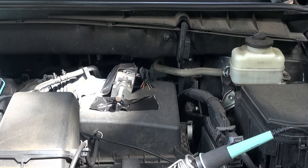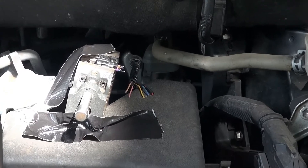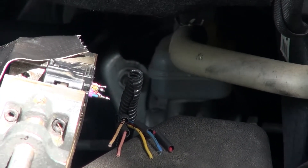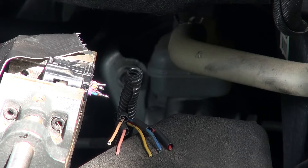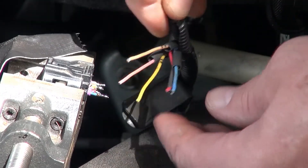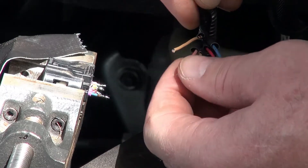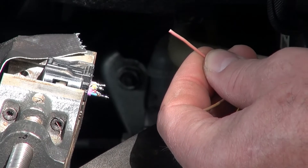I've got the short wires on the connector tinned and it's in a clamp. I'm going to temporarily tack the wires back in place and see if I can reset the code and drive it around — there are some other things I want to do. This is just a temporary repair; I'm going to have to replace that pigtail because the wires won't have proper strain relief and they would break again. But it'll work for a few minutes while I move it into the shop. Here are the wires tinned, and I've got them marked with stripes. Starting with pin one — closest to the wiring harness — that's this pink wire, just stripping it back a little bit.